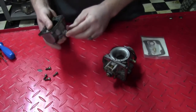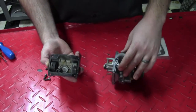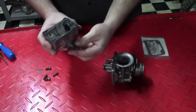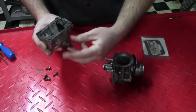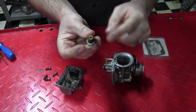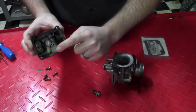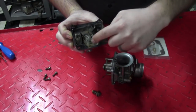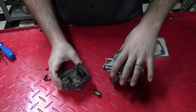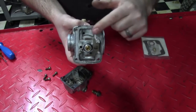Another unique portion of this carburetor is how the main jet circuit operates. Because this is a rotary valve engine, the carburetor sits behind a cover and is enclosed in the engine cases. There's a plug on the outside cover that you remove, and then to access the main jet you use this unique style of banjo bolt. There it is — there's your main jet on the end of this banjo bolt, which has holes in the end. The fuel enters one big hole down there, goes into this chamber, then into this depressed portion in the casting.